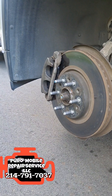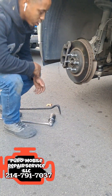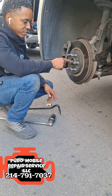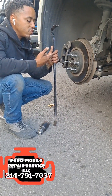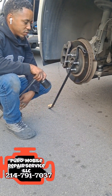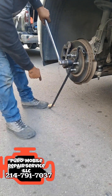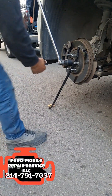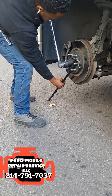It's too tight, so I'm going to show you a different method to get it off. This is going to be a super duper hack for all of you that are having a really tough time getting off these axle nuts. We got the gooseneck — what you want to do is set this in between your studs, then position the breaker bar right against the floor so as you rotate it clockwise, it's against the floor.